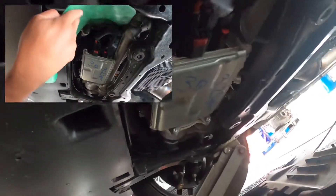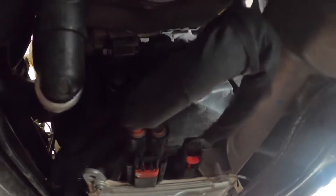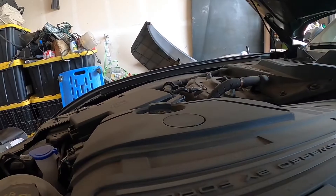See how much easier it went in this time. If you notice, I put a green bendable funnel, because Ford decided to put the steering computer — this is electronic steering — right on top of the oil filter. I don't think it should get soaked in oil. This thing takes 10 quarts of oil, so let's add 10 quarts of oil.